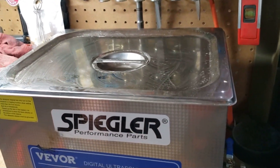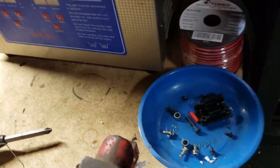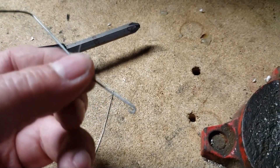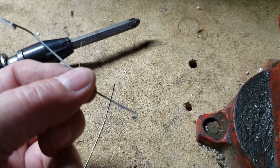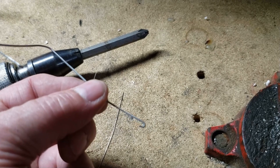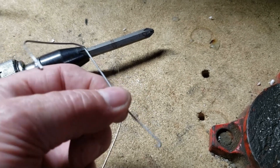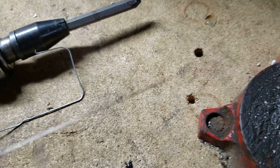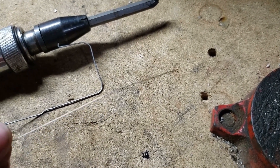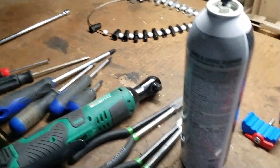I also use a little piece of guitar wire that I've made into a hook tool. This one pulls out the really small washer and o-ring down in the low-speed idle jet, and it pulls out the spring for that assembly — just hooks it and pulls it right out. This is great for cleaning out all the orifices, channels, and everything that gas or vacuum goes through — a real lifesaver for making sure that carburetor is as clean as it can get.